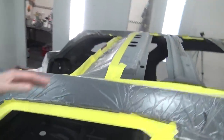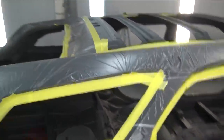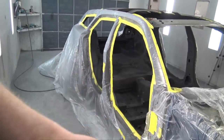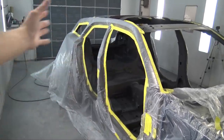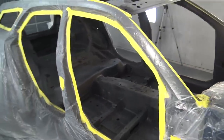Another reason is in the back, when I glue the roof down I'm going to have to seam seal that edge. In the factory that edge is all seam sealed and it wraps around — I also want that seam sealer painted, because if it wasn't painted it'd just be black or white and really wouldn't look good. I think I should have this done in the next week or so, and I'm really happy that the interior is a hundred percent done and even. I can start actually putting some stuff back in the interior now. So we're getting very close — if you like these videos make sure to click that subscribe button, throw a thumbs up, throw a comment below. As always, see you guys next time.